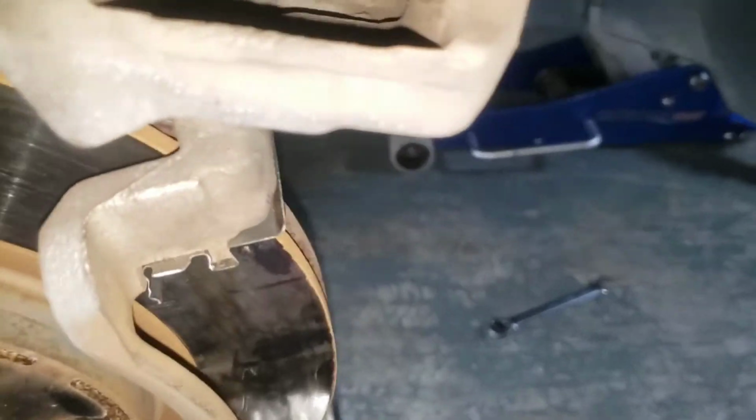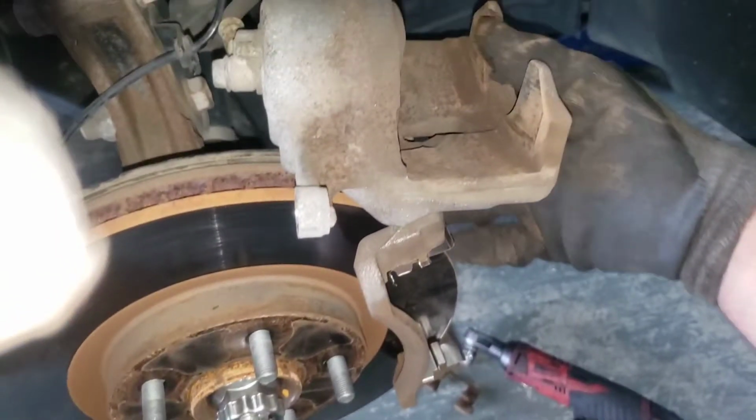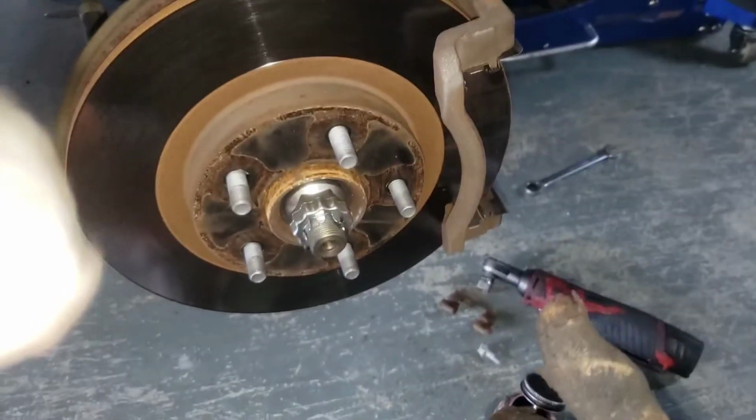And then we're gonna put our pads. Oh, and if you are replacing that, I believe it's a 17mm right there, and just beyond the thing down there, you see that other 17mm down there. So take those 2 bolts off. This bracket will come right off. This rotor will slide right out.